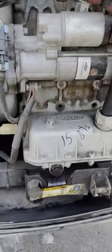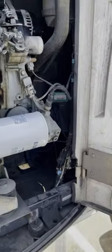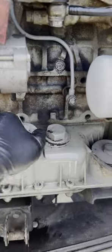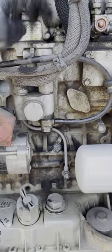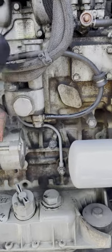Now we just put 15 quarts of oil in — already got it marked, 15 quarts. We'll turn it on, get the engine hours and today's date, and we should be set. After you put your 15 quarts of oil in, sometimes you only have to prime it, sometimes you don't. Just turn it on and see what happens — in most cases you don't have to, but if needed, just prime it and it'll start.